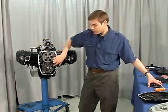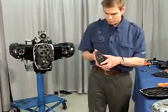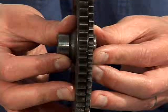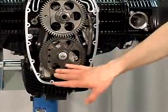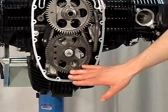You'll also notice that this gear here no longer utilizes a split gear. I have here in my hand an old gear from an older K2X engine, and you'll notice it utilized a split gear to keep noise down. Due to this change in bearing design, they have now omitted this split gear and have simply gone to a regular straight gear without any split gear application. This change was also done across the whole K2X lineup from October 2007 as well.